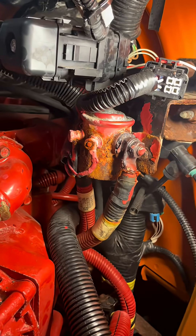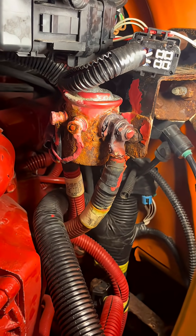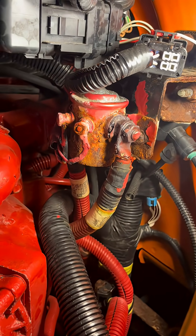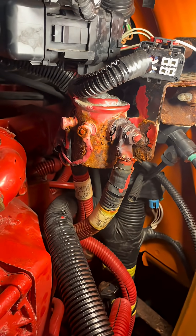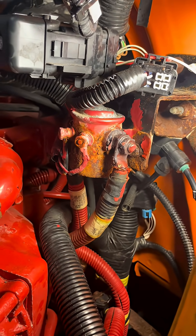I found the draw, and to be honest with you, it didn't take me that long. Look at that solenoid and look at that terminal on it — that definitely looks like it was getting cooked to me, and that solenoid doesn't look great to begin with. That goes to the intake grid heater, and I was kind of suspecting that might be the issue to begin with.